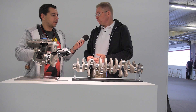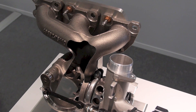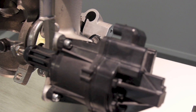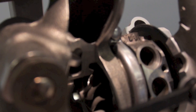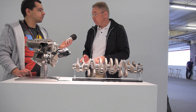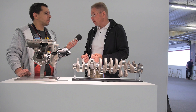What's the advantage of having two turbochargers rather than one? It's about response. One of the main goals in developing this engine was to benchmark it for response — to be as good as possible in turbocharger response. For this reason we chose two small ones. We have a very small turbine which is able to react very fast, and we have an electronically controlled wastegate that gives us the possibility to react fast and extremely precisely.